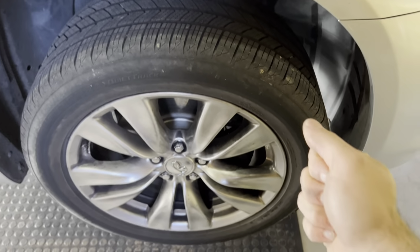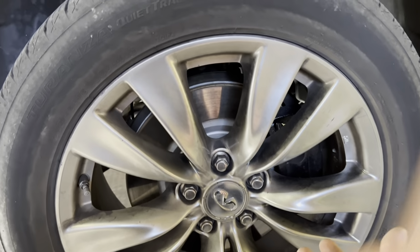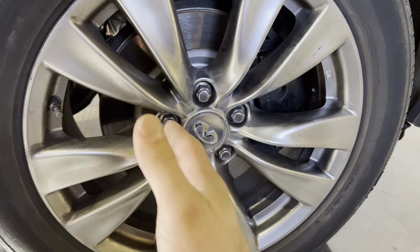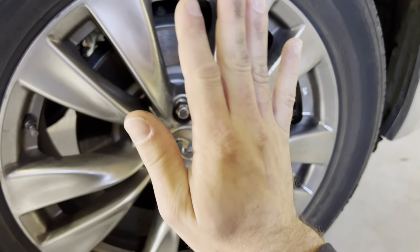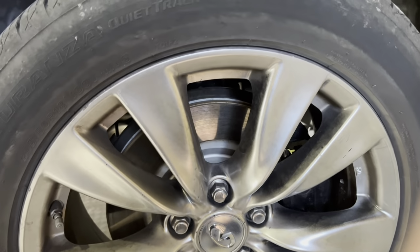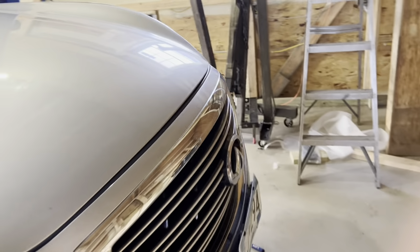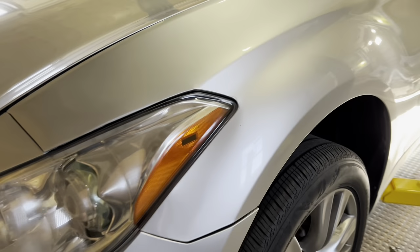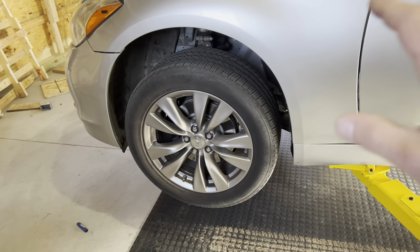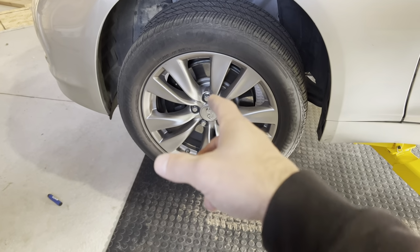Now, obviously, there's the shakedown test. If you can move the hub, right? So you basically get right here and you rock the wheel back and forth, not side to side. That's checking for steering linkage, but this way checks for ball joints. And if the bearing is bad enough, it will physically be loose. You'll rotate the wheel back and forth, kunk, kunk, kunk, as you're trying to move the wheel. This has not a single loose part on the entire car. Everything is solid. I shook it down earlier when the noise was just faint. Nothing loose. This bearing is still tight. It has absolutely no play.